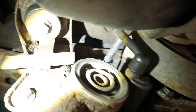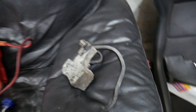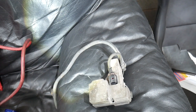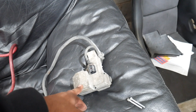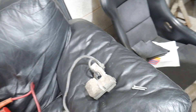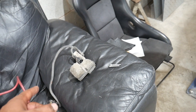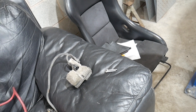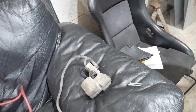For those who've been keeping an eye on the build, the Haldex pump is missing, so I've got a replacement. Luckily these are the same across the platform - same as the S3 8L and the TT Quattro, so anything on that platform basically. We're going to get that in now. Hopefully that deletes one of the fault codes as well.